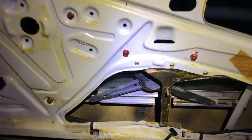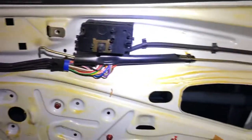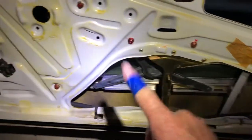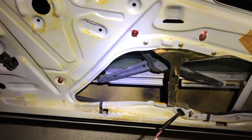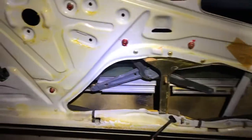Here's the W124, my son's car. I just fixed a window switch for the driver's side because it wasn't going up, and now he comes home and this window was stuck halfway. I have everything taken apart. I think it could be the motor — it makes a kind of buzzing, grinding sound. It does go up a little bit every once in a while. Let's see if it was working and then just stopped making any noise. I don't know if it has a timeout or something.